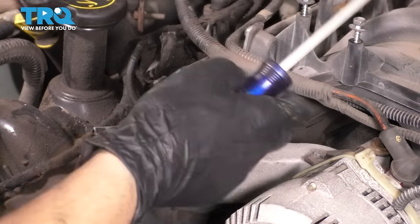Okay. Next, you have to get the valve covers off. I'm gonna start with this driver's side here because you can see it better on camera. I'm still gonna show you the passenger side, but it's gonna be the same thing. And like I just said, you get a better view over here. Okay, 8mm bolts all around both of these valve covers. Let's go for it.